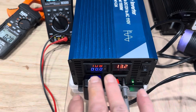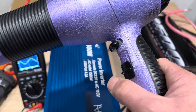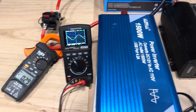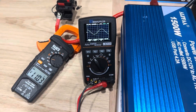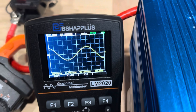I had to sit the inverter up a little higher to get this plug for the inverter killer hairdryer. So I'm going to turn it on cool, which is its lowest setting — that's just running a little motor on low speed. Let's see what happens. 11 amps on the DC side, wave still looking good.